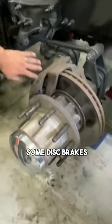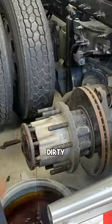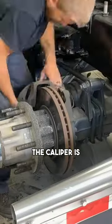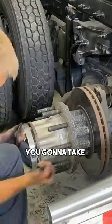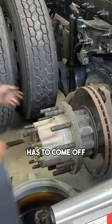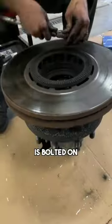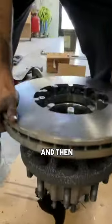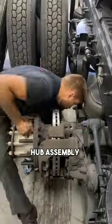Today we're going to be doing some disc brakes — it's going to be fun and dirty. Step number one is you've got to take the wheels and tires off. The caliper is right there. Take the cover off — this whole hub has to come off, and then the rotor is bolted on from the back side. So you just go ahead and put the new disc on, and then you can stick this whole hub assembly back together.